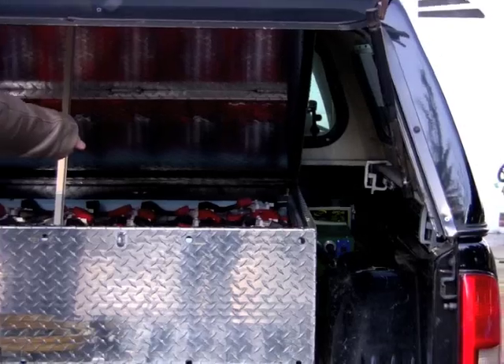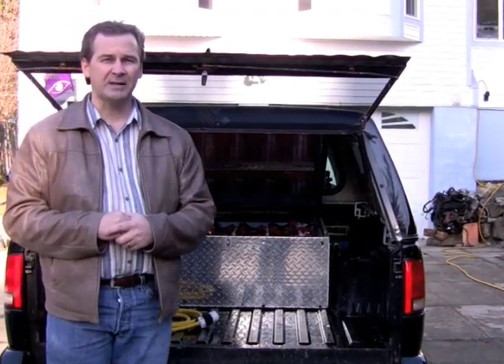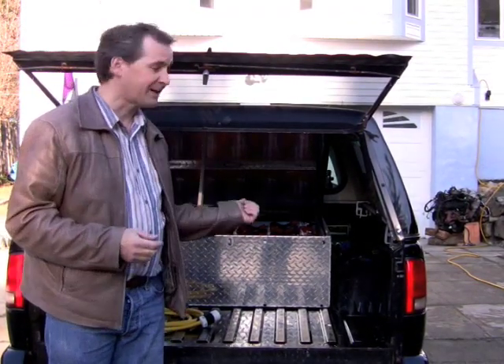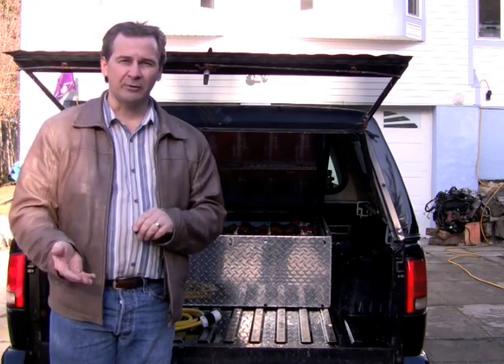Those are 20 lead acid batteries in the back, and I have six more up front — 26 total. They're a deep discharge type, commonly known as golf cart batteries — it even says 'golf cart' right on the top of them. Each battery block is a 6-volt battery, not 12-volt, so 26 of them in a row makes a 156-volt battery pack. Deep discharge batteries are the same material and chemistry as a regular 12-volt car battery, but they're built differently so you can discharge them quite a long way without damage. On a typical car battery, if you discharge past about 80 percent of its capacity you do a lot of damage — but other than that, they're the same.